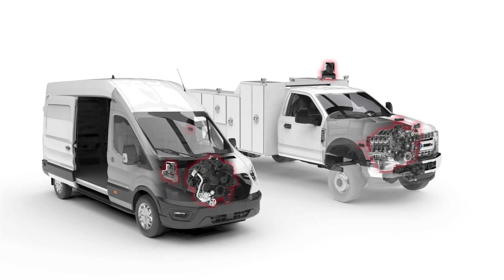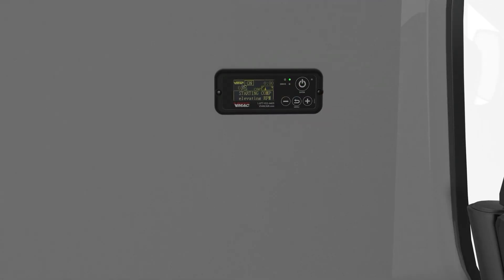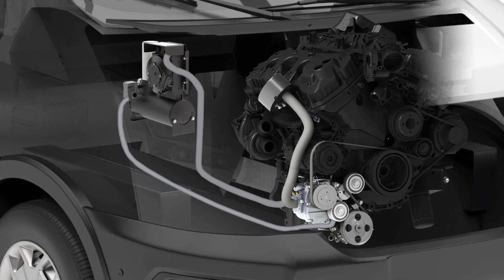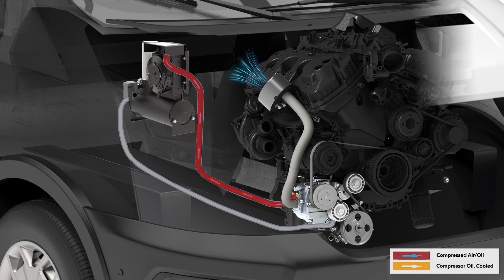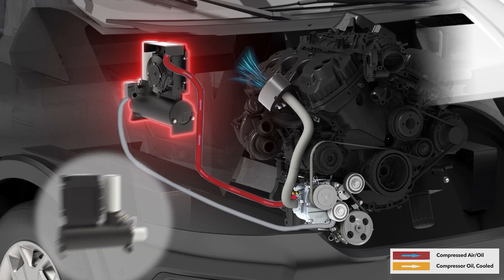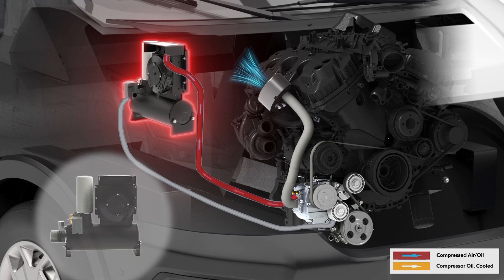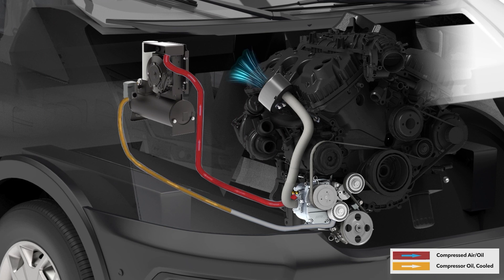Underhood 40 air compressors for trucks and vans operate similarly to Underhood 70 and 150 systems with some minor differences. When the operator turns the system on, the clutch engages and the throttle control increases engine speed. Once the system has built up to operating pressure and filled the air receiver tank, the clutch disengages and engine speed returns to base engine idle. While in operation, the compressed air-oil mixture is sent to the WASP tank, which mounts in the van's cargo area or on the truck's service body. The WASP tank is a patented waste heat-air separation package that combines an air-oil cooler, separator tank, and filtration system. After filtration and cooling, the compressor oil is returned to the compressor. As the operator uses air, the clutch will engage and disengage, and the vehicle engine speed will adjust to the throttle set point to generate maximum CFM.